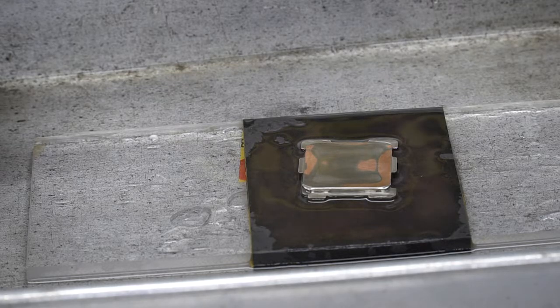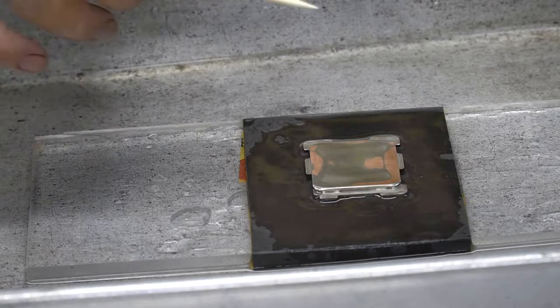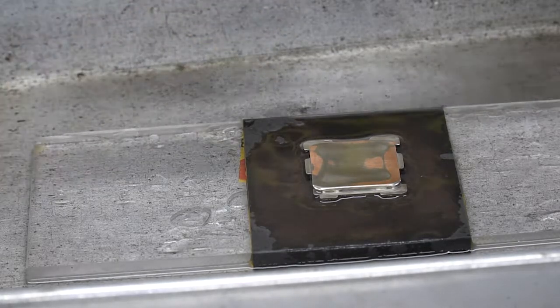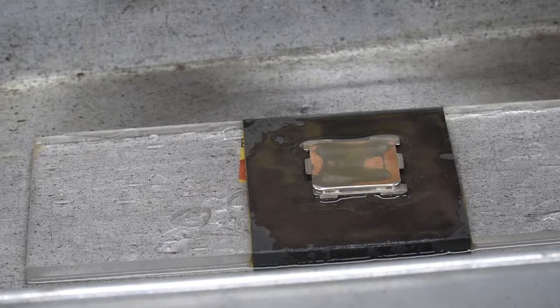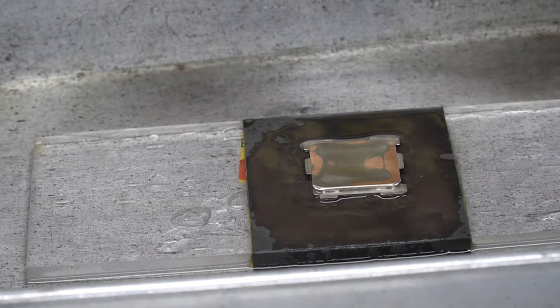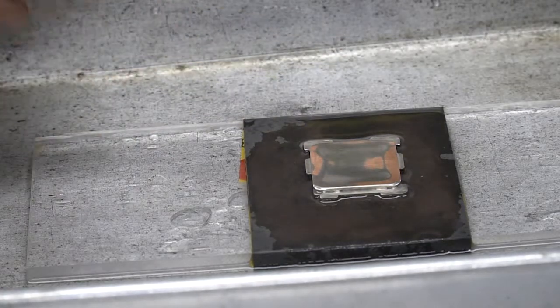Now, I was a jeweler, goldsmith, and setter for almost two decades prior to this, so I know how to lap and I know what I'm doing as far as making things flat, how to hold it, rotate it, and apply different pressure. I'm going slow and easy. The primary goal here is flat. It isn't speed, it isn't polish, it's flat. And this is really showing my high and low spots.